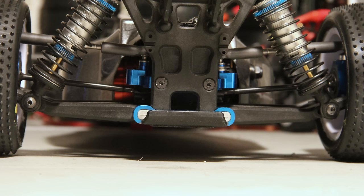Now, this is how you adjust roll center. So, you have your ball studs — looking at the back ball studs. If you're adjusting the inside ball studs, if you raise the ball stud, it's actually lowering your roll center. If you lower the ball stud, you're actually raising the roll center. So it's just the opposite — whatever you're doing with the inside ball stud, that is the one that's closest to the center line of the car. But if you happen to have vertical ball studs on your hub carrier, then if you raise the ball stud height, you're actually raising the roll center.